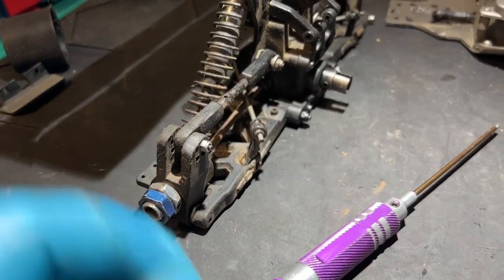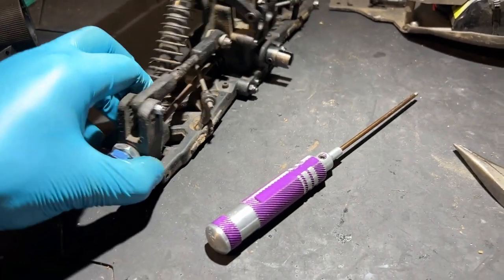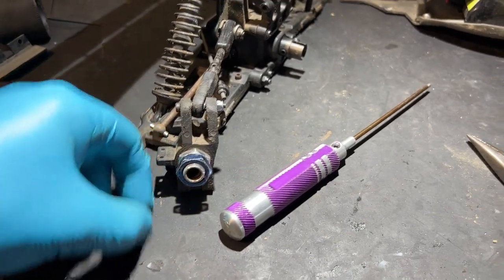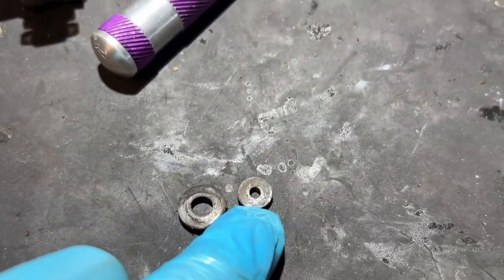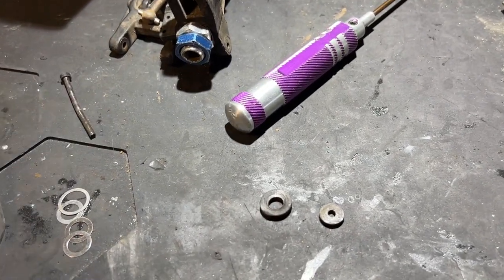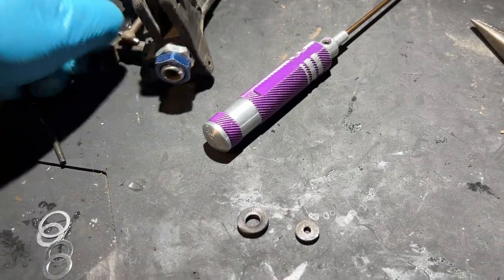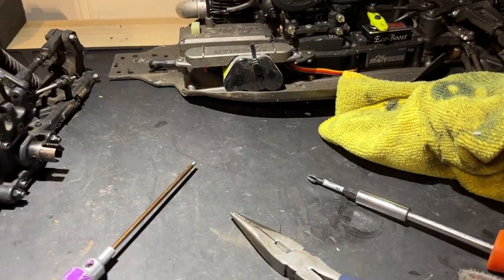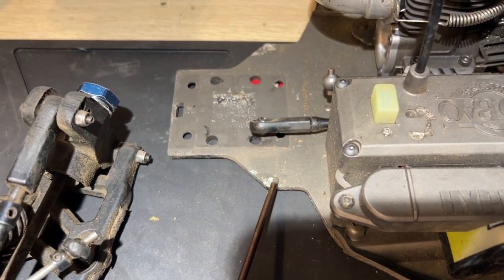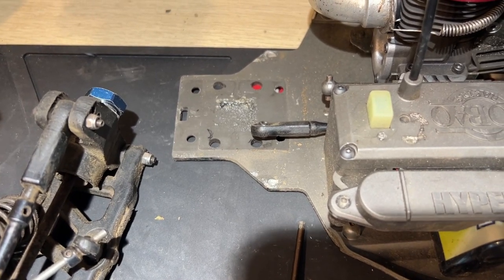Basically all back together — got these nylon nuts replaced on both sides, so that's all done. This screw is a little bit bent up, which is causing some hassle with the binding up of the rear end. This was the little spacer I was talking about — that's the one that should be in it. The one that's been shoved in here is rubber and flexible, so it allows the knuckle to move around, which is why that screw has bent. We'll get that screw straightened out, then rub one of these off the parts car and get that in there instead, and that should solve our rear binding issue. Then I'm going to take the car out to the garage — you can see the A-arm is just about touching on the chassis, so I'm going to chamfer down this portion of the chassis to get a little bit more droop out of the rear arms.